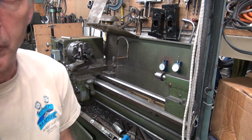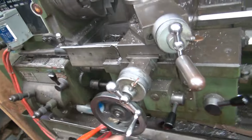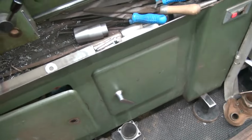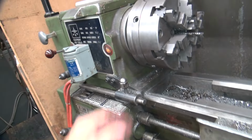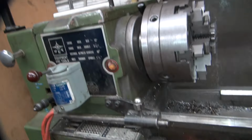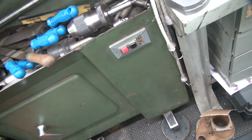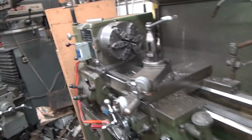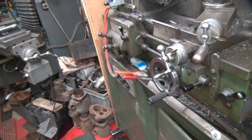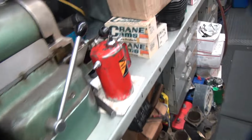So right now, the lathe's got a big twist in it. Over time, the twist should come back out. It'll settle, and it should come out. Because right now, all the weight's on our 2 feet. It definitely moves around a lot, so it's got a lot of tension on it. Yeah, it's bouncy, bouncy. The whole lathe's moving a lot. That's because we don't have equal weight on all the feet. That's because it's twisted. All right, we're gonna wait, see what happens tomorrow.